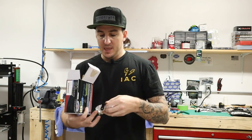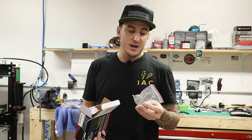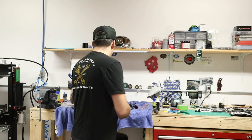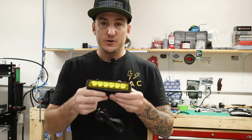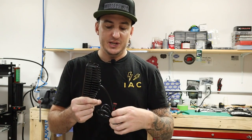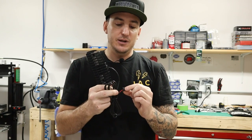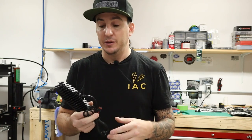We've got some small cap head screws in here, we've got a bolt which we're probably not going to use, and we've got a little Allen wrench for those cap head screws. What's worth looking at more than that stuff is the light itself and the bracket that comes with it. The light obviously has a yellow lens on there, and then it comes with a nice length wiring harness. It's got what looks like the same as a factory plug — I'll hold that up there closer so you can see it. You're probably not going to use this plug, but it's there and it works with the wiring harness that they have.